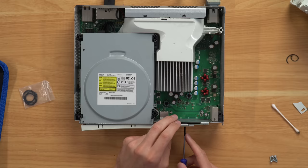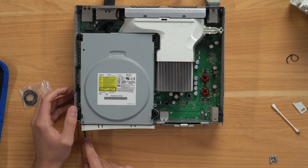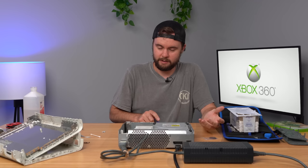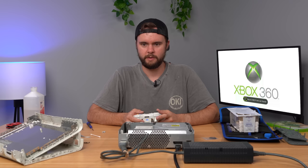Let's go ahead and see if it works now. I'm going to press the power button here, and hey, it's not making the crazy screeching noise now. Let's go ahead and press the disk drive eject button. There it goes — it's coming out pretty slow, but it does come out. We probably need to do some more cleanup in there and it should eject better, but man, it's opening and making normal noises now. That's a great sign. Let's go ahead and see if this Grease movie that was in there works. Okay, I don't think I've ever seen this notification pop up where it says 'Secure HDCP link not found.' Oh wait — I have it plugged into my Elgato, so it's not going to work. That makes sense.